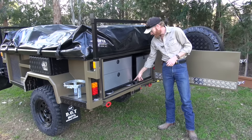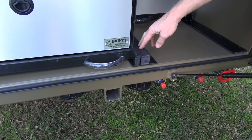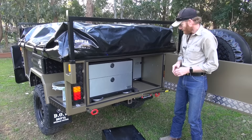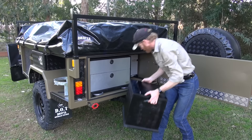The package deal comes with a packer in the middle — it's a timber packer. The Teflon strips are extra but you do get this packer, which you screw down into the floor of your trailer — generally three holes from underneath. That's what separates the kitchen and the storage box. It's very quick and easy to fit, taking about ten minutes. If you also want the Teflon runners it will take a little bit longer, but it makes a better finish.